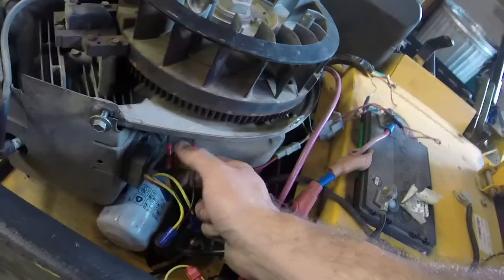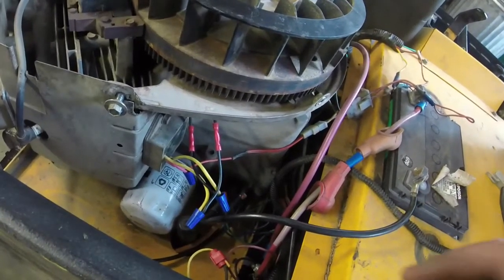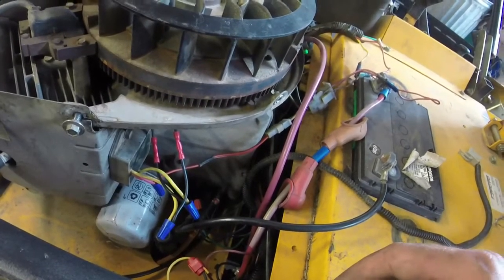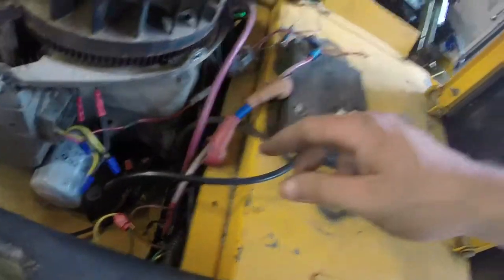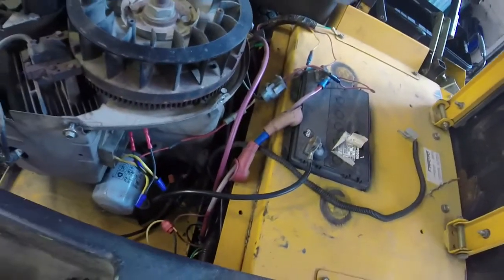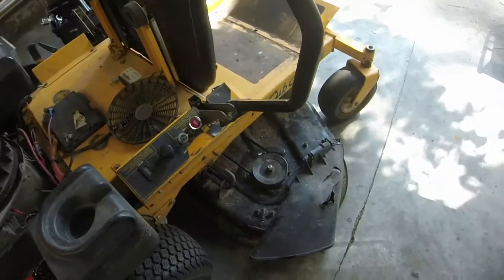The AC tested out 30 volts coming from the coil, so that was good too. So let me work on this a little bit more and see if I can get it to work a little bit better, and more consistently, because it seems like it's still a little bit all over the place, and I don't really like the way that it's close to this engine block, so with the wiring harness. So let me work on that a little bit, maybe extend the wires a little bit, and see what we can manage there.